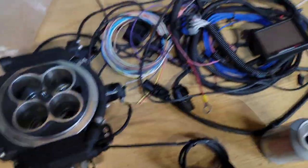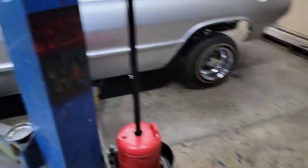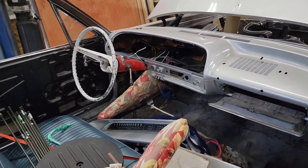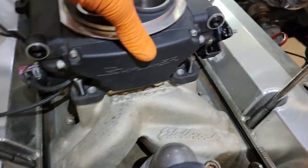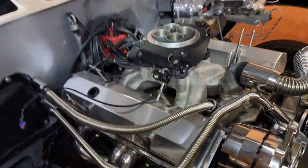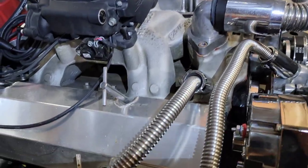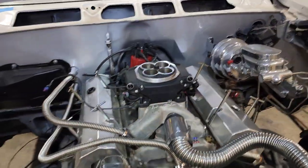It's got a new fuel pump, the Sniper wiring harness, everything else. We've taken off the carburetor and we're going to run EFI. We just dropped on the Holley Sniper — had to shorten up the studs on the intake. We're going to change that out to a brand new gasket. Test fitting, making sure everything works. Found a vacuum port that was too high for this to mount back up, so we're going to use the vacuum off the Sniper system for the brake booster. Timing will be set by the Sniper box itself.